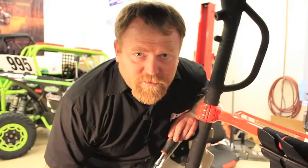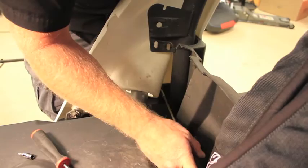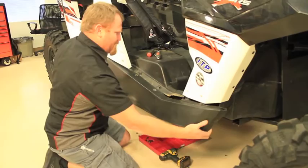There's also a sneaky little hidden screw down here by the filler neck on the passenger side. It requires a 9/32 to remove. You want to make sure you get that out before you can remove the quarter panel. Once all hardware has been removed, the rocker panel will drop down out of place — just set it aside for now.